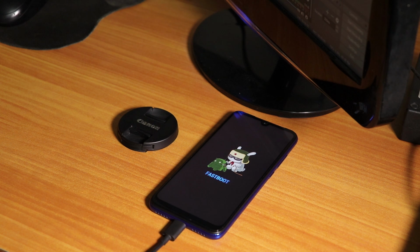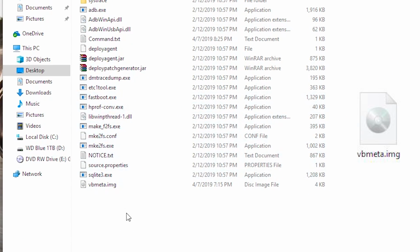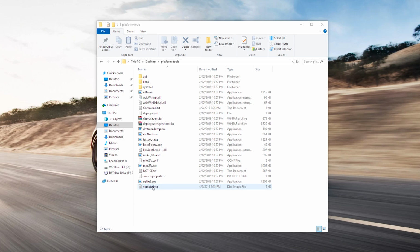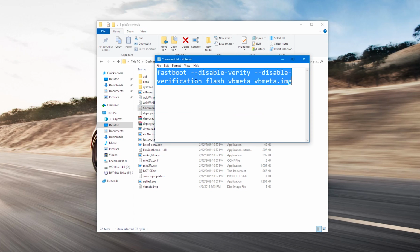Now we have to do some stuff on the PC. Now on the PC, extract the platform tools zip file, and after you open the extracted folder, it will look like this. This folder is really important, otherwise you can't simply flash this vbmeta.img file, and that vbmeta.img file is really important too. So here make sure to copy this vbmeta.img file, and we need this command which I will provide in the description box below.